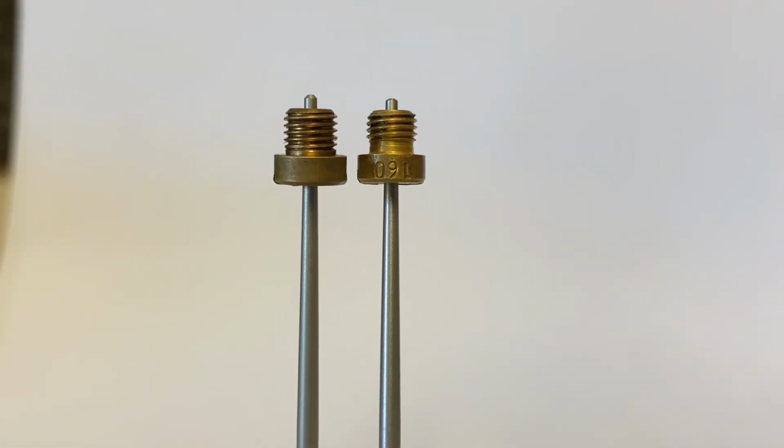And I could see this when we finally got to a point where two jets would sit evenly with each other on these needles. And just to make sure that there was no microscopic difference between the two needles, they were both official Dellorto K57s, but just to make sure there were no mild differences, I tried the test on either side. So I swapped the jets over from one needle to the other, and it repeated the same results over and over. So what's the upshot of this?